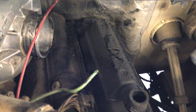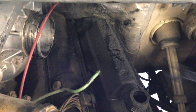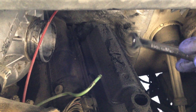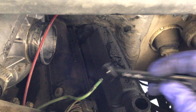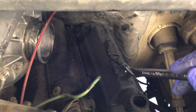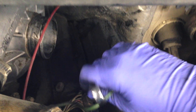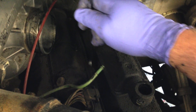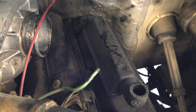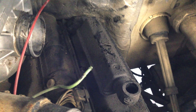The only trick I can share for taking this valve cover off—the bolts are pretty much straightforward except for the crankcase ventilation. Don't take it off because those seals are swollen and you'll have problems getting it back together. If you do, injector O-rings do fit. Instead of removing that, just take an open-end wrench, loosen the bolt up here underneath a few turns, and you can take it out by hand. That saves you a lot of time and you don't have to look for O-rings.